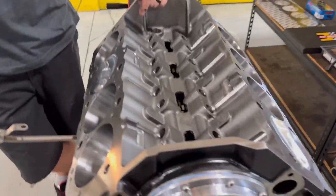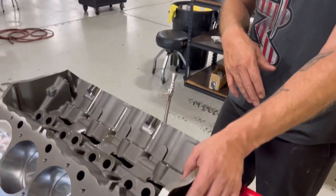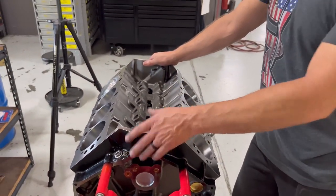Anyways, so we are gonna go over now and look at the cylinder heads. Short block is all done, timing pointer on, balancer on, oil pump set, all those heights and clearances, everything is all set right here. This is still using an 842 lifter. We'll go over that when we put those in. Camshafts in and degreed, went over that. So let's go check out the cylinder heads. I'll show you how those all go together. Talk about everything from the valve springs, valve spring pressure, valve sizes, and all of that.